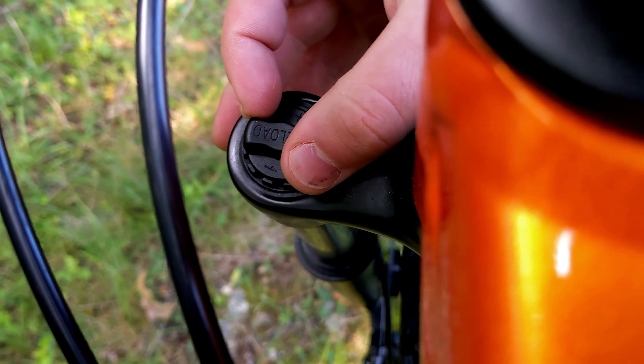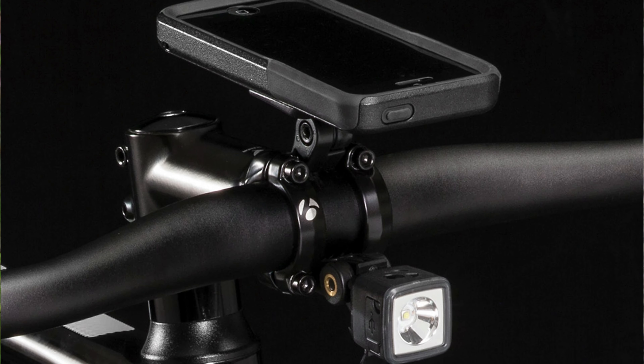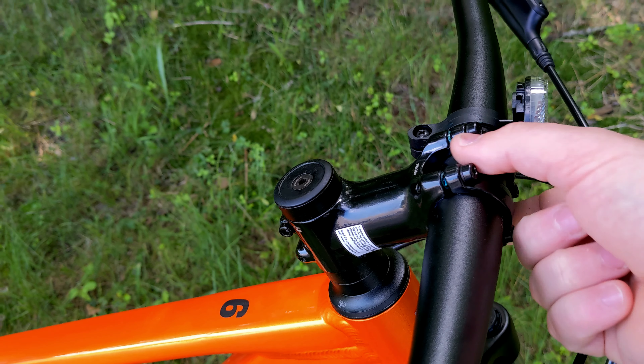For cockpit components, we're talking all aluminum. There's a Bontrager 31.8 aluminum handlebar going through to a 31.8 alloy stem. This is a Blendr stem, which allows you to add lights, a bicycle computer, or your cell phone, all mounting right into the notch. Going out back, the Bontrager Arvada saddle is mounted on an aluminum 31.6-millimeter seatpost. Even being an entry-level mountain bike, it comes with lock-on Bontrager grips. Lock-ons use a little bolt to keep them from twisting, which is a real nice feature since grips can get loose over time.